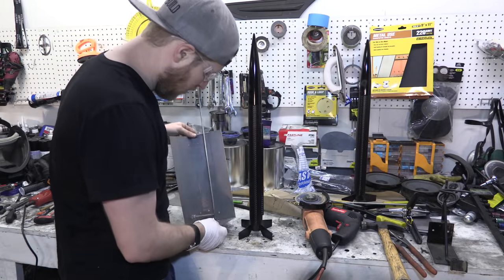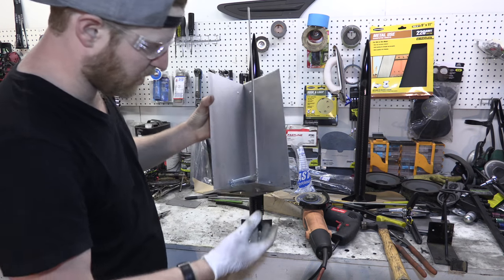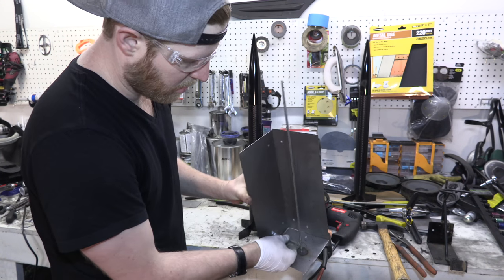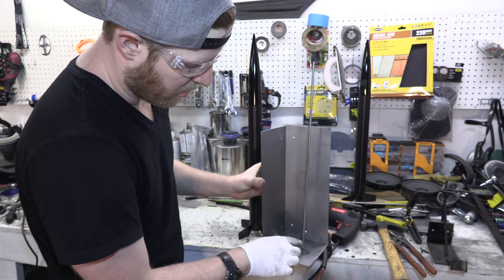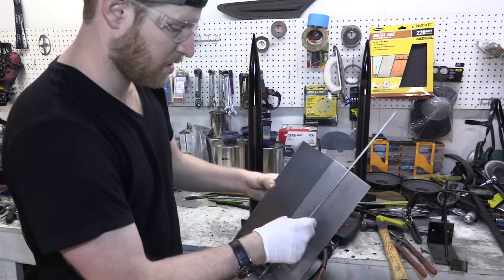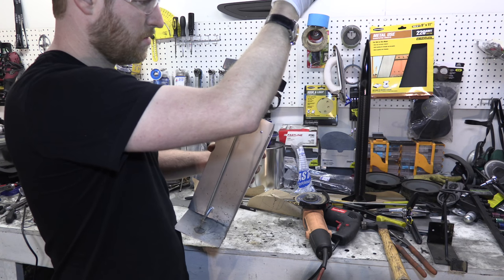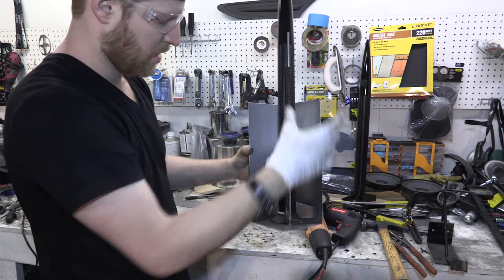Yeah. All right. We have one of these things made. I have to really quickly make another one, but I just wanted to show you what it looks like. So we've got our three pieces all bound together, riveted together, and then we have our rod that came out, and I grabbed some of this threaded rod, threaded a hole through here, got a bolt here to hang on to this piece, went up and welded it to my rod, and then in the back I welded it as well to the sheet, so that's nice and sturdy and on there. Then grab our rocket, figure out which way the fins go, like so, rocket slides down, and it's nice and in there.